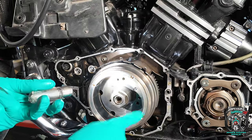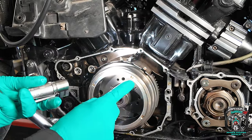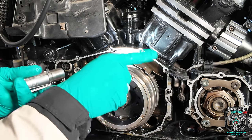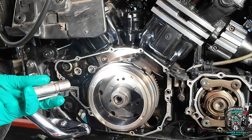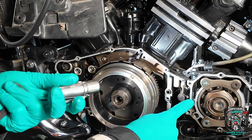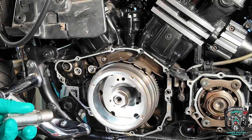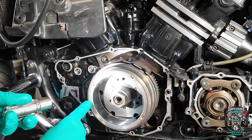I know what you're all thinking — it's got a different ECU on it, maybe something's going on with that. Maybe there is. We also have a little bit of a question mark over the amplitude of the two signals from the crank position sensors. I wasn't paying attention to which two had the low amplitude signal — it'd be interesting if it was the rear two cylinders.